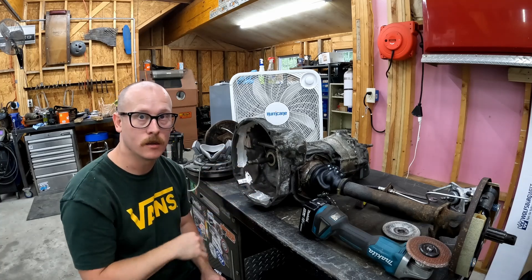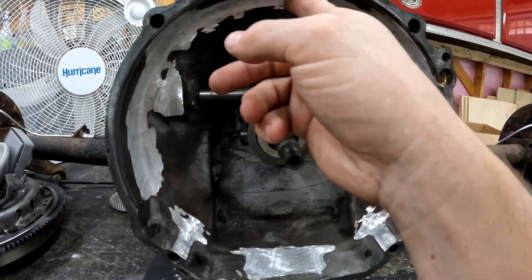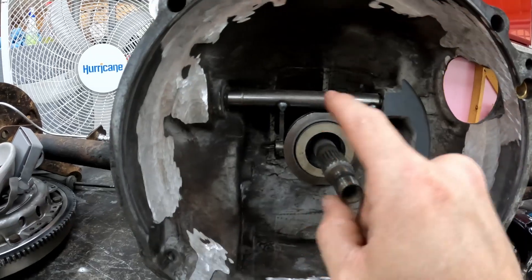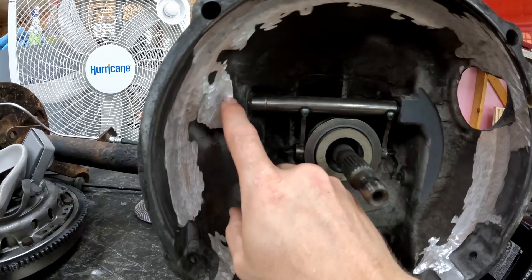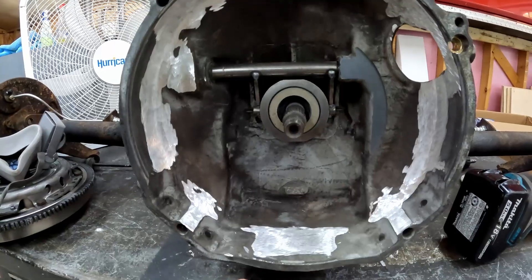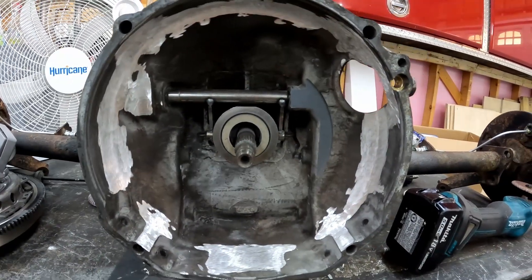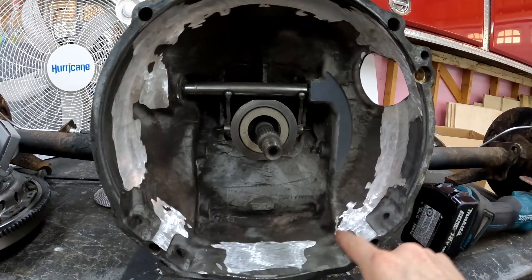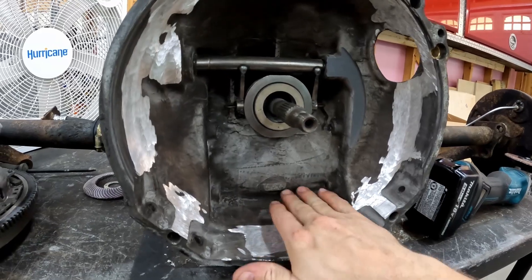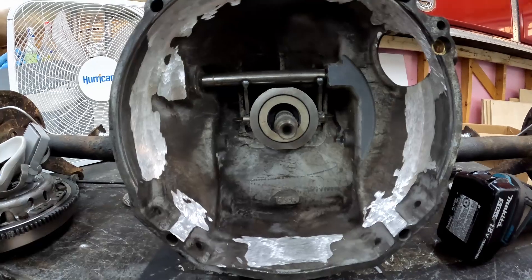The bulk of it is these four spots we started with, then we've got the bottom, our sides, and a little bit on the top. We also have this nub around our clutch arm shaft — this needs to be ground out for your pressure plate. Very similar to the other areas, you'll end up with a few little witness marks here; just grind a little bit. Be really careful in this area because you can grind too much. The main theme is: go slow, remove material a little bit at a time. Now I'm just going to take my die grinder with the cylindrical flat disc and smooth all this out — we don't want to create any hard or sharp edges where stress could locate and crack, so we'll blend it all out nice and smooth.